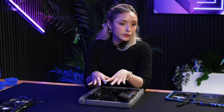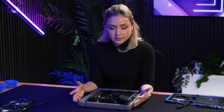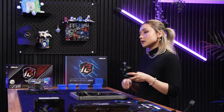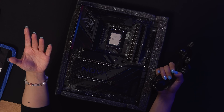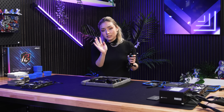We're going to do the finishing touches on the motherboard — two things. First, we're going to install the bracket for our cooler at the back. It's easier to do this outside the case than after the motherboard is installed. Second, we're going to attach the CPU power cable at the top left corner of the motherboard. This will make things easier — all we have to do is feed the power cable to the back of the case, because once the motherboard and cooling are installed, it's difficult to insert the CPU power cable, especially if you have a very small space to work with.